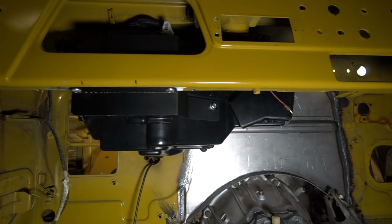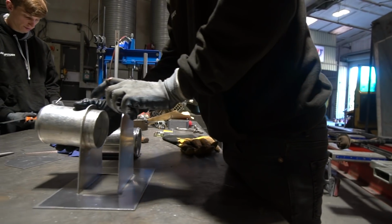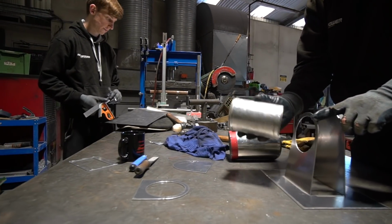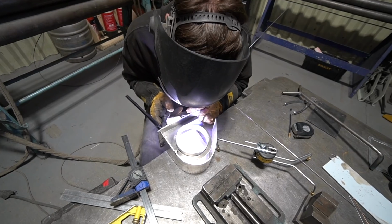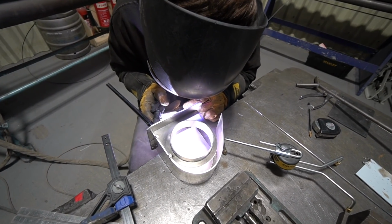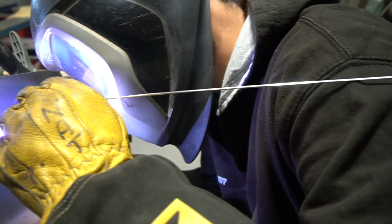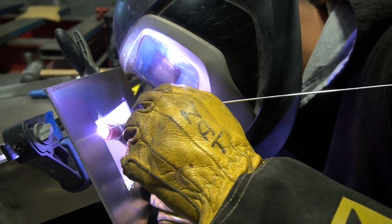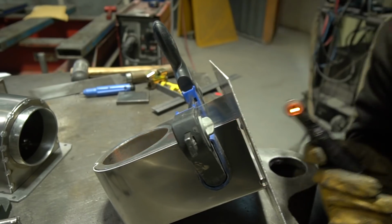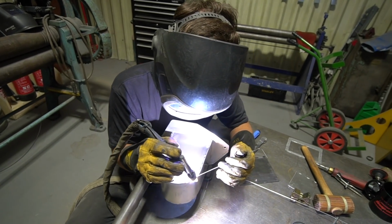So we basically fabricated an aluminium manifold. It's a two-piece manifold that Scott's made, half of which goes onto the vintage air unit, half of which goes onto the bulkhead, and then there's a round tube that joins the two, which ducts the air intake to that vintage air unit from the engine bay. And then we're going to use probably a replica of the original heater box, but with a modern fan inside it, in the original place, still intaking through that original louver setup. So it's going to be quite a neat setup, and it still intakes in the original way. So really happy with that.